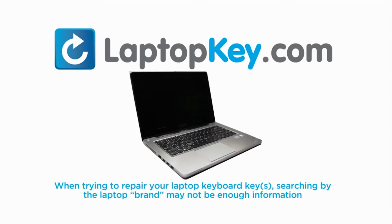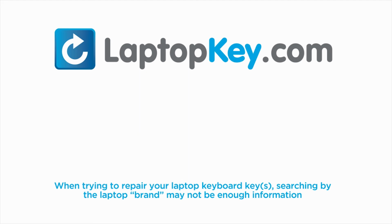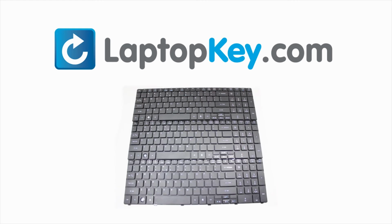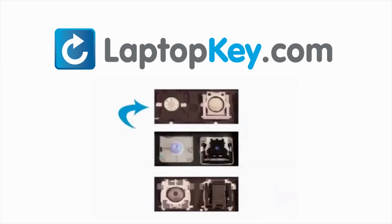Notice, when trying to repair your laptop keyboard keys, searching by the laptop brand and model may not always be enough information. Many times, laptop manufacturers produce keyboards that look the same on the outside, however, have differences underneath the keys. The differences include the hinges, retainer clips, and cup color.